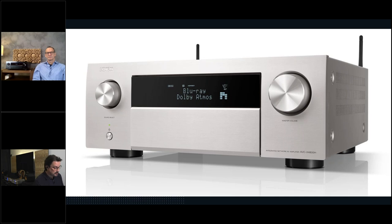Regarding audio precision measurements like those done for the Marantz AV10 — do we have similar measurements for the 4800 to share? Not for the 4800, but I'll show some in two weeks' time for the AVC-A1H. Someone also asks about using spare channels or internal amplifiers to drive passive subwoofers. In that case, I would really recommend adding an external amplifier — I wouldn't load the AVR receiver with driving a passive subwoofer.